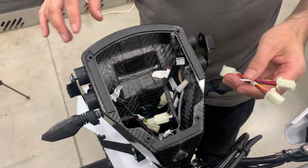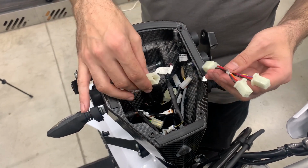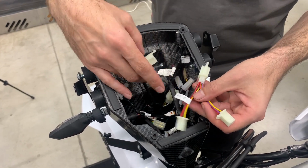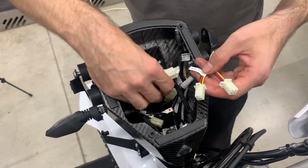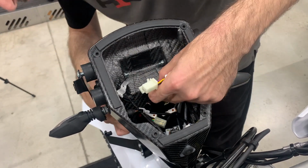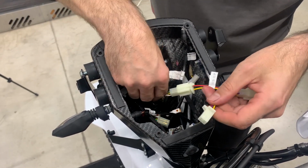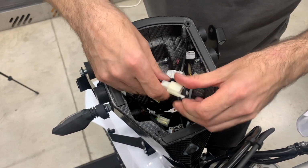Now we need to connect everything perfectly together, where we start with the headlights. This was also included in the headlight box. What is very important, here is marked high beam. So double check which of the connectors from the headlights are high beam. We said high beam is the upper light with the shorter tube, so I double check. And now we connect. Now we take the other one from the low beam, we connect.